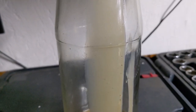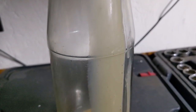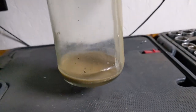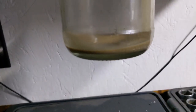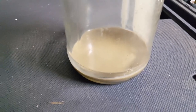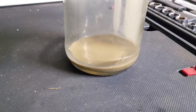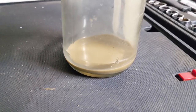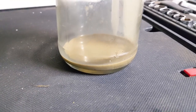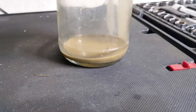The stuff poured into the jar looks fairly milky, and that's because it's basically water vapor mixed with oil vapor coming out of the crankcase of the engine. As we can see, it's not a whole lot — but that is about one ounce. My truck currently has about 2,300 kilometers on it and we installed the oil catch can at around 600 kilometers, so subtracting those gives you 1,700 kilometers. That works out to about one ounce per roughly 2,000 kilometers.